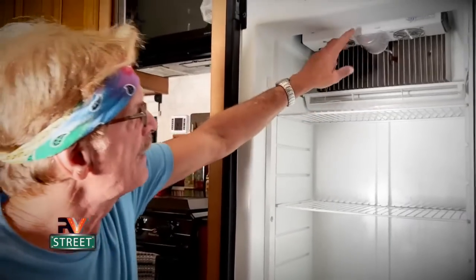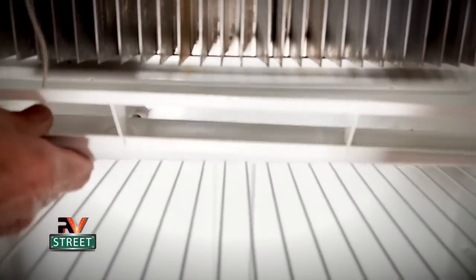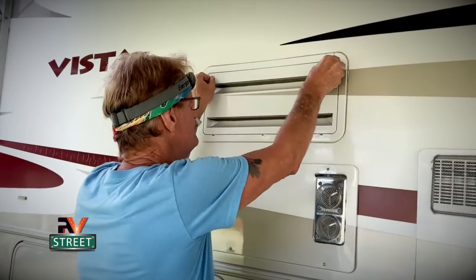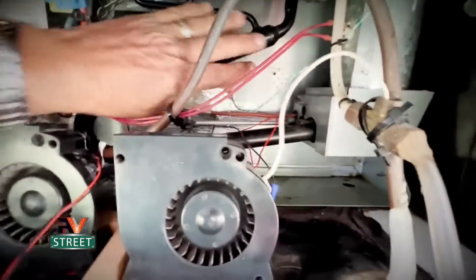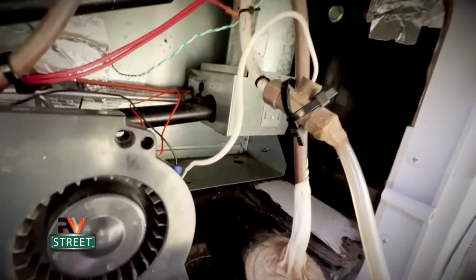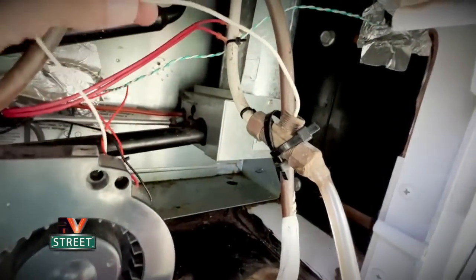I tied mine into the light. So we have this wire right here coming off the top of the fan. On the drip tray, you can see the drain line right there. This wire comes down and goes through that drip tray — through the hole in the drip tray — and then through the tube on the drip line that goes to the back of the refrigerator. Now let's go to the back of the fridge outside. Here is the access panel to my refrigerator. You see my drip line right here? Normally this drip line goes into a little drip tray back in here. Well, I removed that drip tray and I continued this drip line. I went to Home Depot and bought some brass fittings right here and made my own kind of a tee, where this is the wire that comes out of the top of the fans I showed you inside.